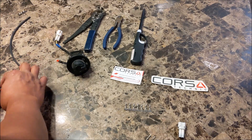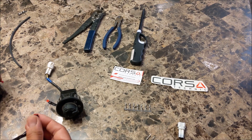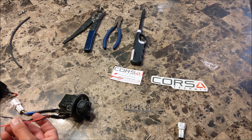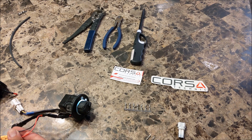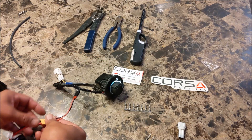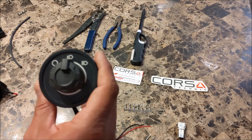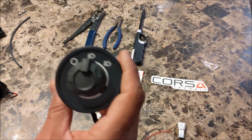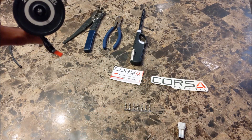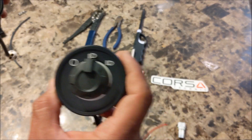Here's one benefit to doing your own: Yamaha uses standard blue for everything, but I used a white LED for the lights switch. There's the white LED. The reason I did that is the less time I spend looking at the dials and the more I concentrate on the road, the better. By having my light switch white and my mode selector blue, I can really quickly just glance and know which is which.